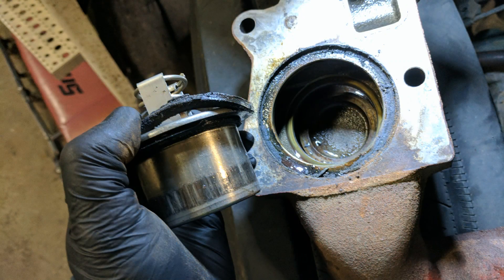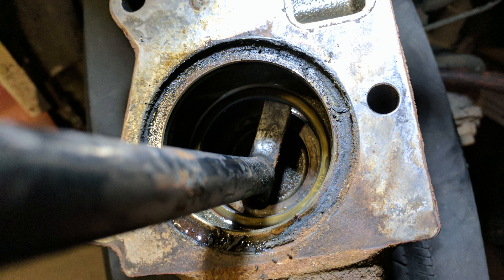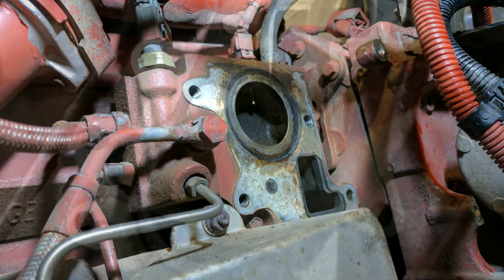In this particular case, the rubber seals on the thermostat had deteriorated to the point where they were leaking by. Next, you want to remove the thermostat and use a pry bar of some sort to pop the seal out of the thermostat housing. Remove the old gasket — either from the thermostat housing or from the side of the engine, whichever place it held on to — and clean up the surfaces below it.